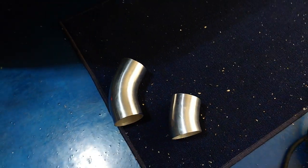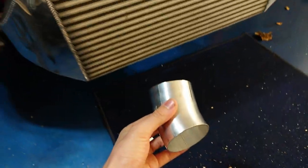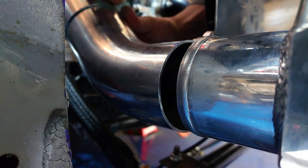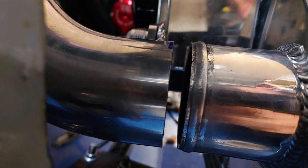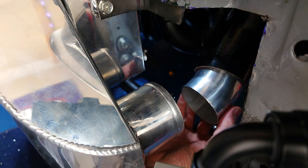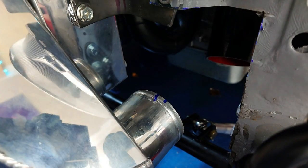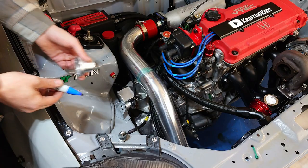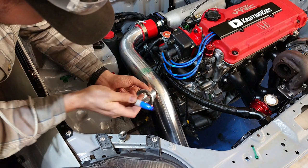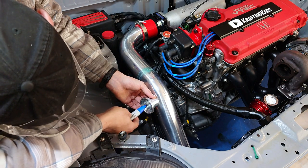Alright, we're back from cutting with our last two pieces of piping — we have our 45 degree pipe that's going to go on the left side and our 25 degree pipe going on the right side. Let's go ahead and tape them up and see how they fit. There we go — for the right side, go ahead and shove our pipe in. It looks like this piece wants to line up right about there. Another important thing we can't forget is our blow-off valve flange — this is an HKS blow-off valve flange and I'm going to go ahead and mount it right about here and mark the center.